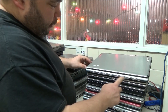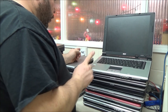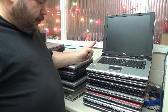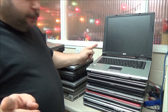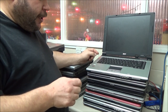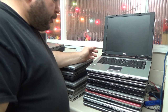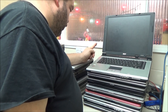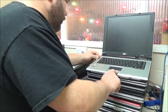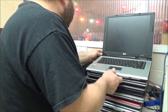We've got another Acer which looks similar to that but all the ports are different. All the plastics are intact. If I remember rightly, one of these Acers did power up and go into BIOS, and the other one - there's a dead short when I plug it in. As soon as I plug in the adapter you hear a crack and the adapter shuts off, goes into its overload protection. But I can't remember which one it is. This has got an AMD Sempron on it and this is an Aspire 3000. There's no sticker on here to tell me what it's running, but the plastics are actually in better condition on this one.